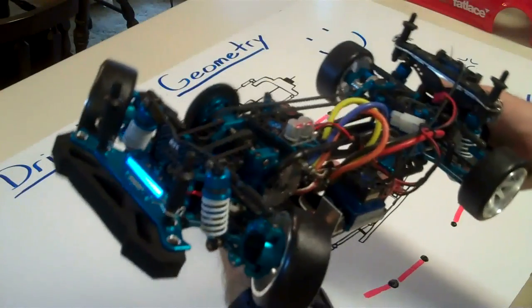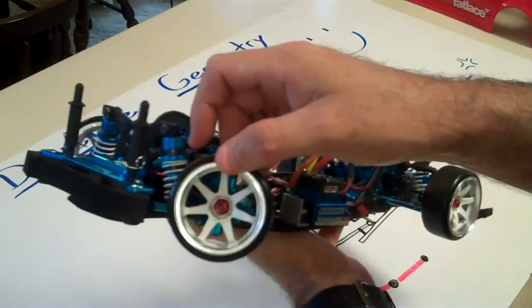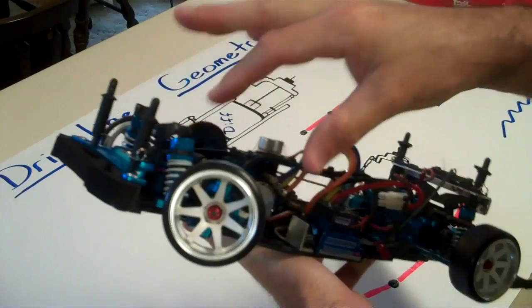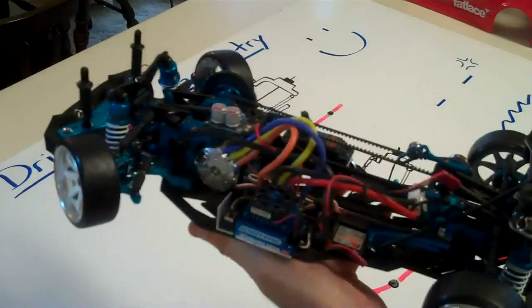You may quickly start ending up with wheel chatter — when you start turning the car, the joint will start binding and the front wheel will start chattering. You'll have to back off your turn-in, which will decrease your turn-in rate.